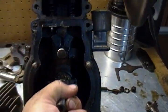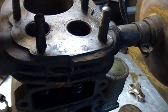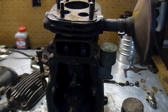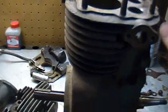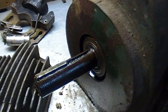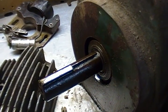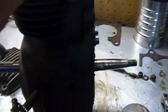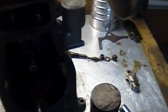The valves weren't actually that bad. They were dirty and weren't sealing well, but they're not pitted or anything, and they're not very loose in their valve guides. In the PTO bearing there's some play as well — might as well replace that. It's a ball bearing. Same on the mag side — it's a ball bearing, which is nice.